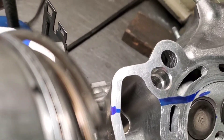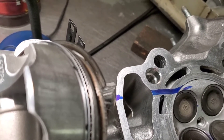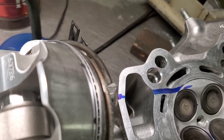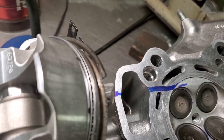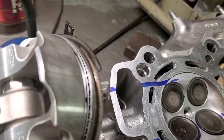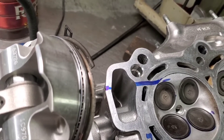You can see here there's the dot — top ring. To add insult to injury, they put the top ring in the second groove and the second ring in the top groove, and installed the second ring upside down. So this poor thing never even had a chance. This is a good example of good parts, allegedly professionally built, resulting in a total amateur mistake.